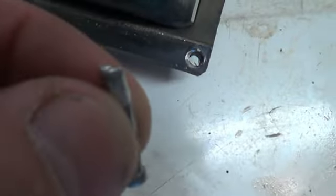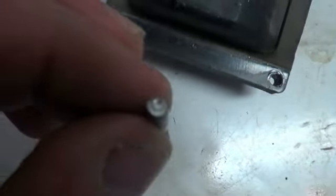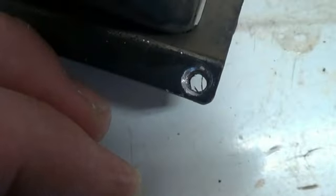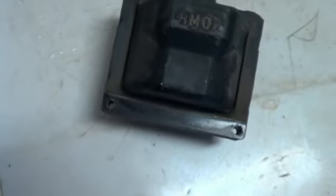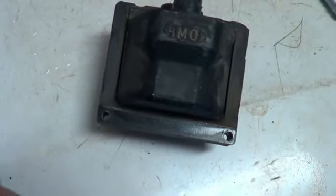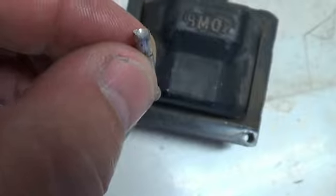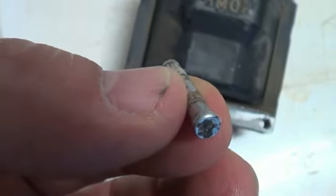When you're drilling this rivet out of this coil, it's going to be this side. This is an aluminum rivet. This is an iron coil. So once you've drilled an adequate amount out, you'll kind of see it break away and you'll feel it change. Really doesn't matter if you drill a little too far. This is your old coil anyway. But you'll notice the change as soon as you drill enough that you pop that head out. Then take a small chisel, drive it through. Once it's sticking out, you can grab it with a pair of pliers, wiggle and pull these rivets out.